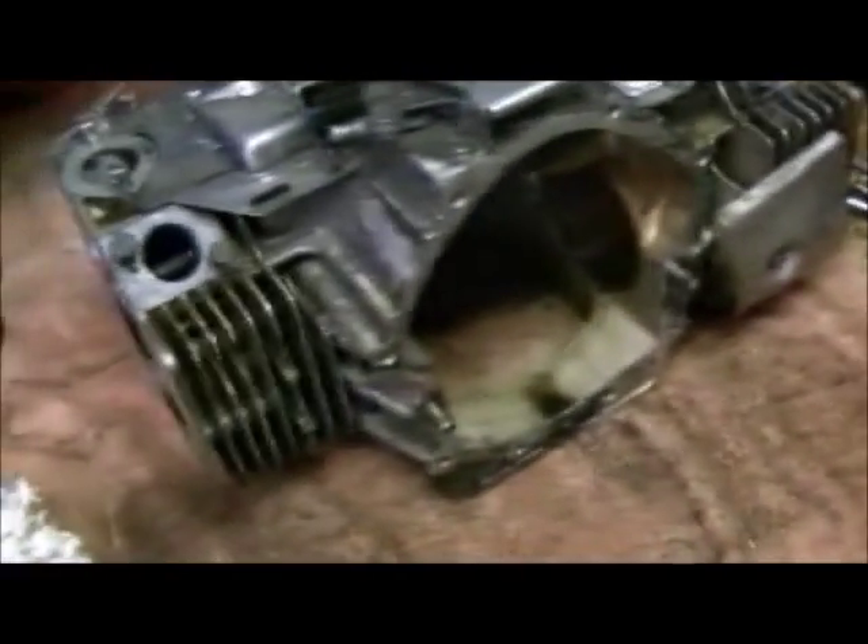As you can see, my workbench has changed significantly in the last hour or so. I've completely cleaned it off. I got an old towel — I laid it down right here just to protect the block so I'm not banging it around on the OSB top. Here is the crank out of the pressure-lubed engine. They are different from the bottom half, but the blocks are still the same. I checked the blocks over. I don't want to move the block too much because it's actually in the orientation that the pistons go back in — there's left piston, right piston.